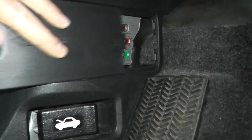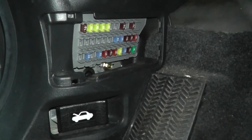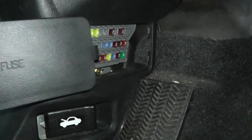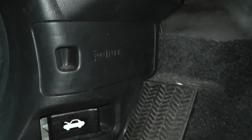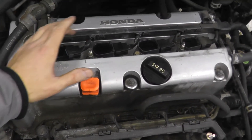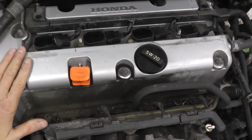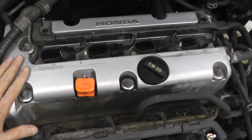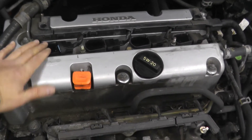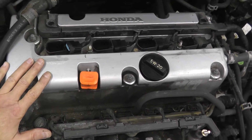If you're curious where the ignition coil relay lives, typically they live inside the vehicle under the dash. For example, I have a fuse and a number of fuse locations right here — pulling off this plastic cover reveals a number of different relays. I'll follow up on how to test an ignition coil relay. So at this point we still have a problem with cylinder 1 — we swapped the coil packs and that didn't resolve it. Power is getting to the coil pack, so ignition-wise we're okay.